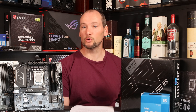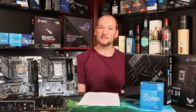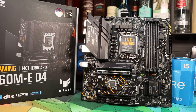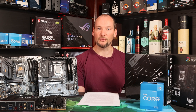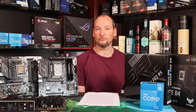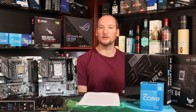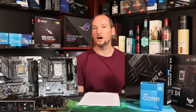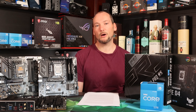So it looks like for B660, unfortunately power limits are a problem again. First the good news: the ASUS TUF is a relatively affordable and decently featured B660 motherboard that will run an i5 or an i7 to full potential. Because it makes life easy by defaulting to enabling multi-core enhancement — when you first boot the board it asks if you'd like to enable multi-core enhancement, press F1 to continue — pretty much any user will hit F1, and that then lifts the power limits. For gaming and general use the ASUS TUF is a fantastic option and a board we'll happily recommend to pair with a non-K i5 CPU. We will be doing a full review in future.